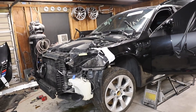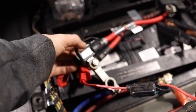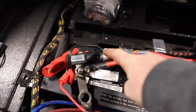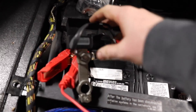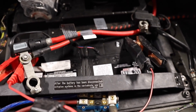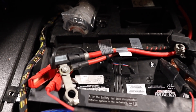I read some comments and they were saying that the car probably won't start — that it has auxiliary power and is able to do some other things, but it's not going to start because of a really interesting thing back here, which is an explosive airbag charge in line with the battery. This is an explosive charge from the airbag system. The airbags were deployed up front, and this little connection and that little guy does look like an explosive charge. That's really interesting. I don't think car manufacturers should put a lead acid battery in the trunk of a car like this if they're going to have some crazy explosive device in the back to detach power in the event of a wreck, but whatever, it's pretty cool.